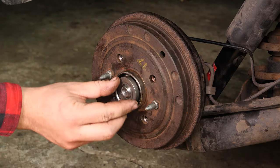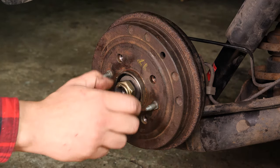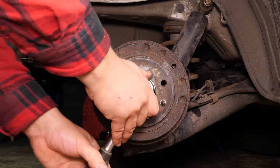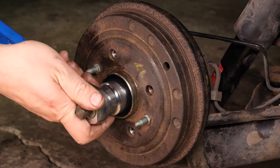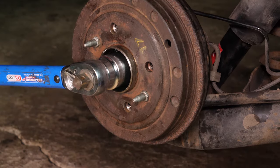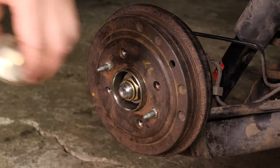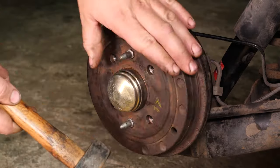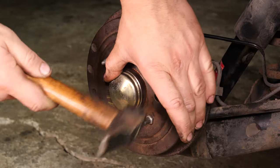Put the external central nut in place. Pay careful attention to properly tighten it using a large socket wrench and a 32mm socket or a torque wrench. Then put the cover back on the nut. After changing your brake drums, it is necessary to bleed the brake fluid to remove the bubbles in the system. We strongly advise you to watch the tutorial on bleeding the brake fluid system.